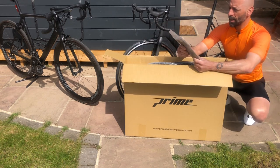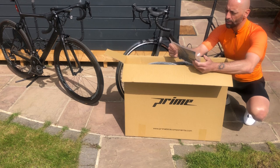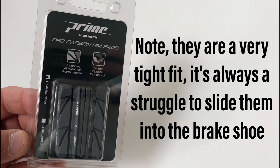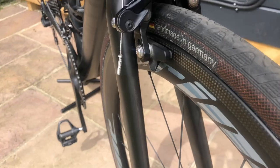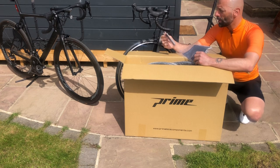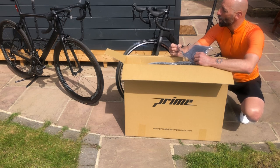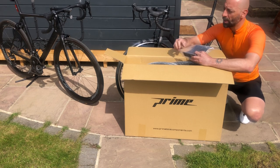The welcome pack includes brake pads. I've been using these brake pads for about two years now and they've been extremely good in their performance. They do wear quite well — the initial wear goes out quite fast, then they stabilize and last a long time. In dry weather braking power is excellent, but in the wet, due to the nature of carbon wheels, it's not as good. At first touch you need to wait for the layer of water to displace from the wheel, and then eventually it will grip.